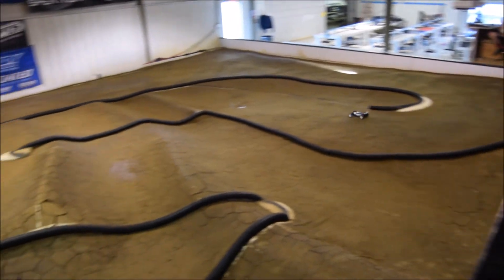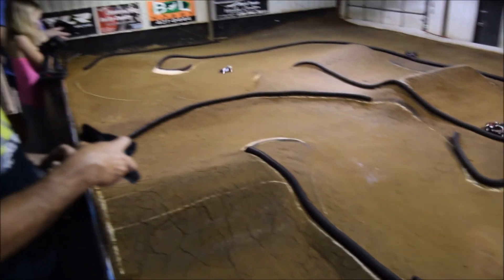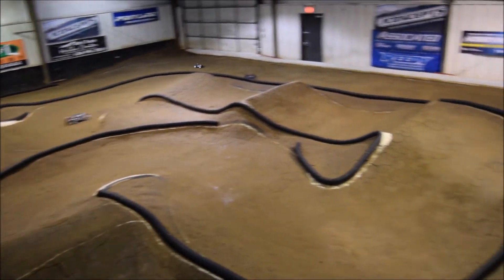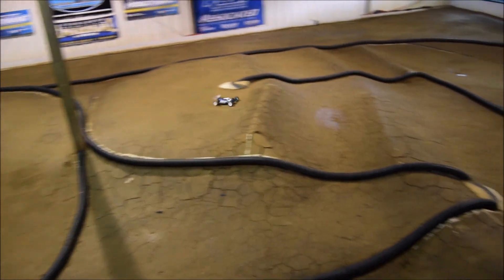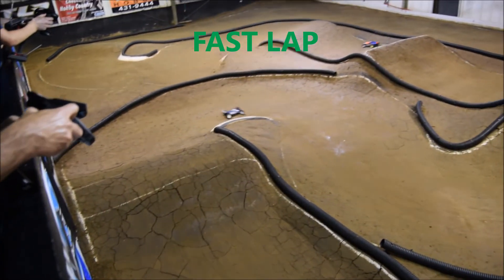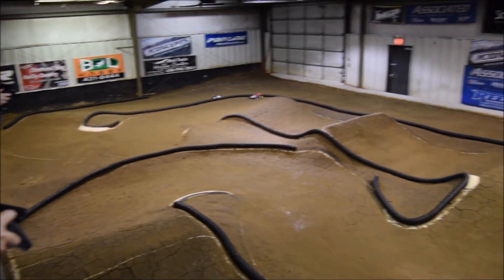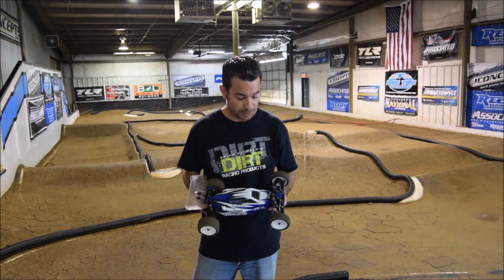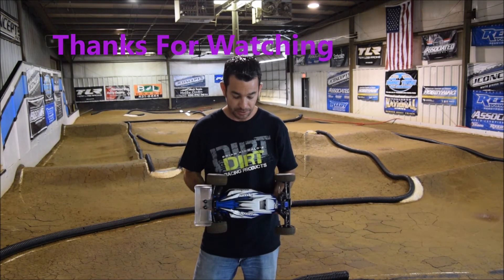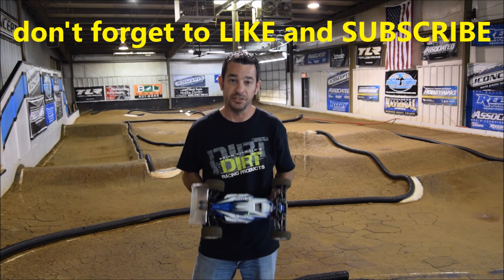18-1, 18-2, 18-0. Fresh off the track after the practice run, after we did our rebuild — we did the shocks, we did plastic — car way better in and out of turns, over the bumps. We picked up about two tenths a lap. Definitely maintenance you need to perform on your car.